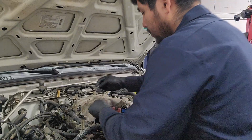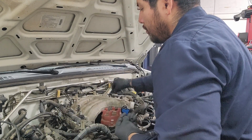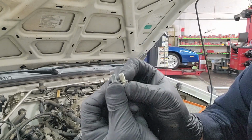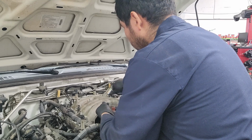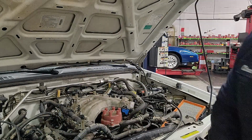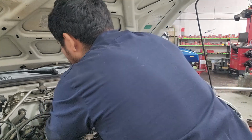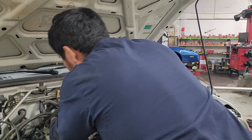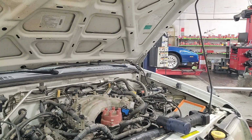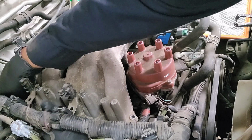One thing that I like to do also is put back the bolts where they came out from. That way, you know where they go, one. And then two, some of these bolts are of different lengths, right? One of them, you can't really see, but one of them is longer than the other, right? It helps you from putting them in the wrong place. So, like I said, we are removing them now with the impact and getting them out. So it's 1, 2, 3, 4 bolts that we're gonna be removing. Let me go ahead and move you guys. These bolts out.